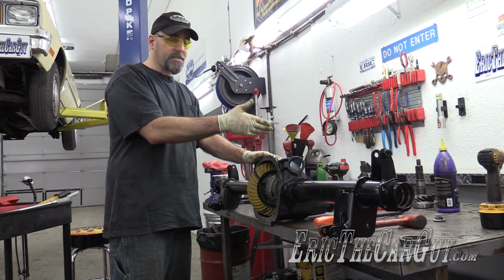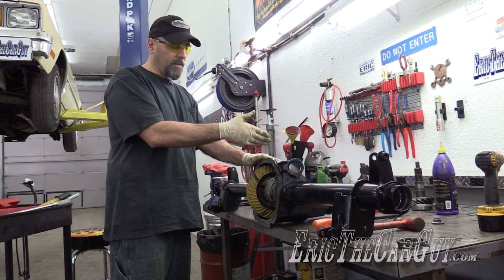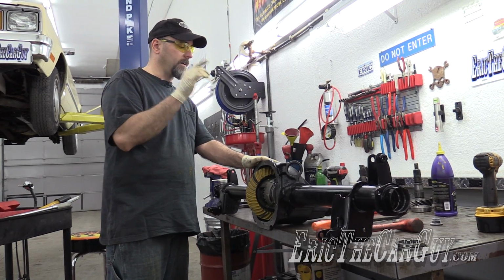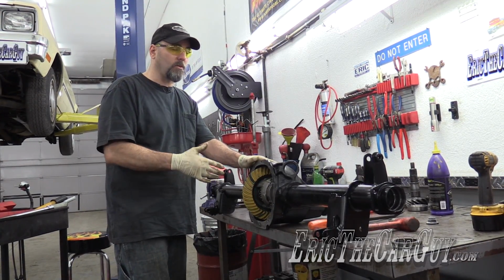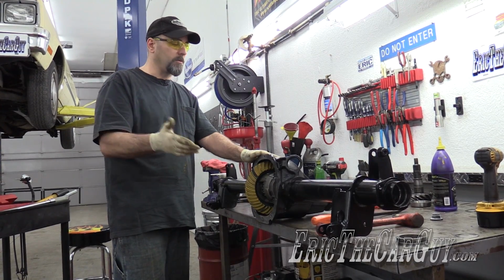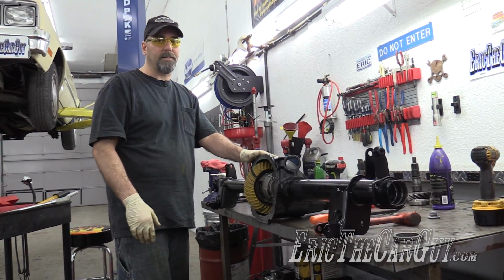And that's why having a setup bearing like what I had before is a really good idea. But make sure you get a new setup bearing and sacrifice it in order to get these correct. It's a lot quicker to do it that way than having to press this off, or have a really good bearing puller like I do.